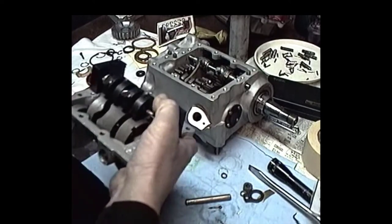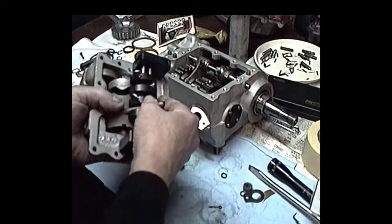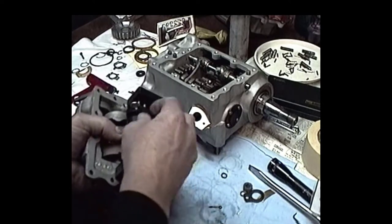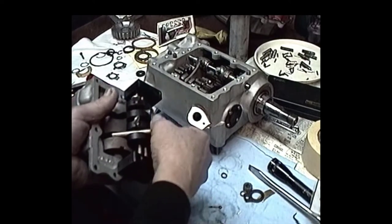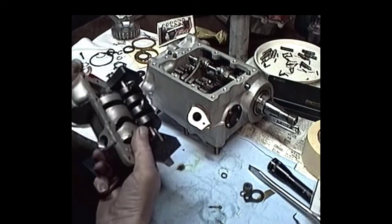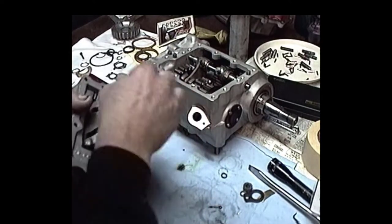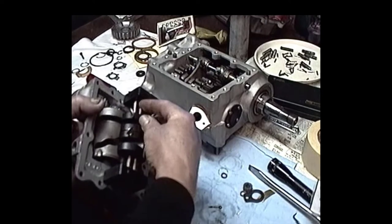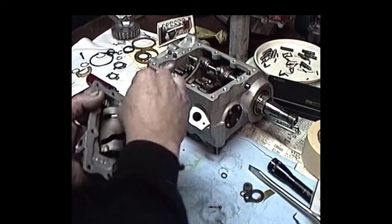What you want to do is get these in your neutral positions, which is going to be for your low gear setting. So you want to get in that neutral track. You've got a pin, roughly a 3/8 pin, which is going to set that. Then I'm going to move this over to the third gear, high gear track. You get these little set screws, loosen them up. See, these things can flip-flop any which way they want. We put that pin in there.